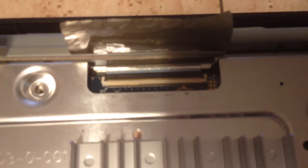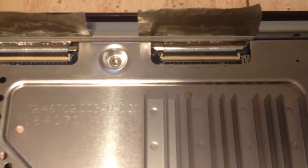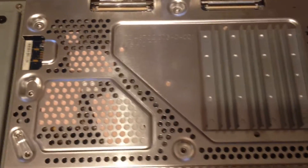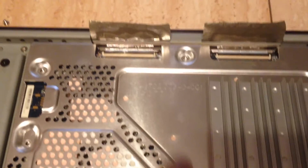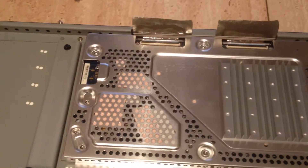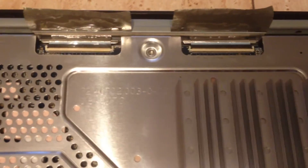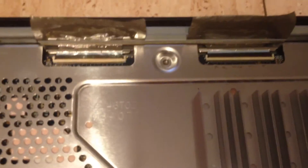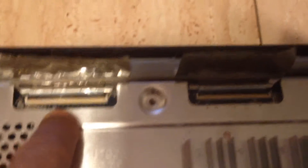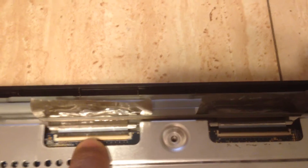The T-Con is under an aluminum cover, which is usually covered depending on the TV set and manufacturer. That T-Con board under the aluminum cover can be fairly easily removed with the screws, though Sony for some reason makes it a little difficult to unplug these two ribbon connectors that connect to the T-Con.